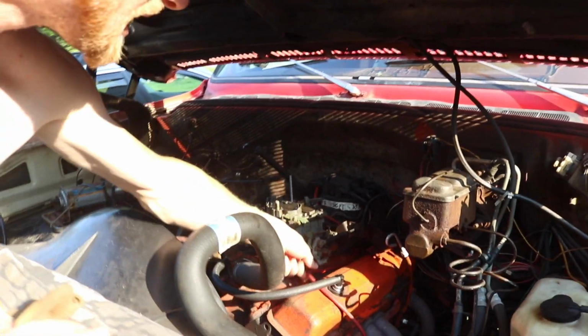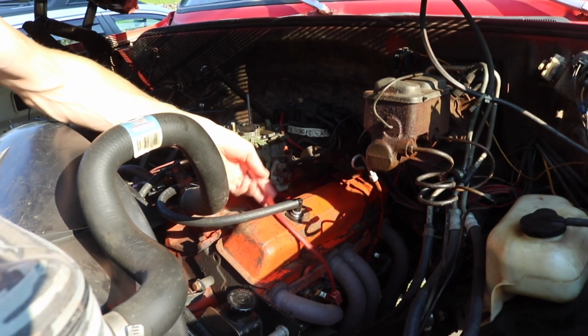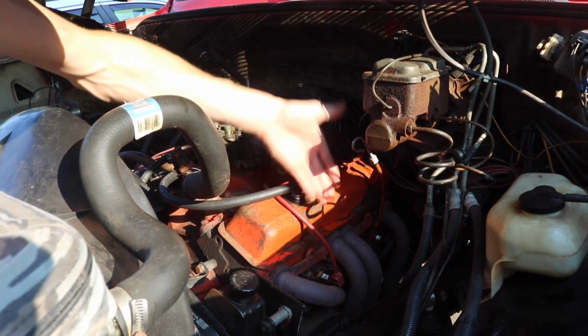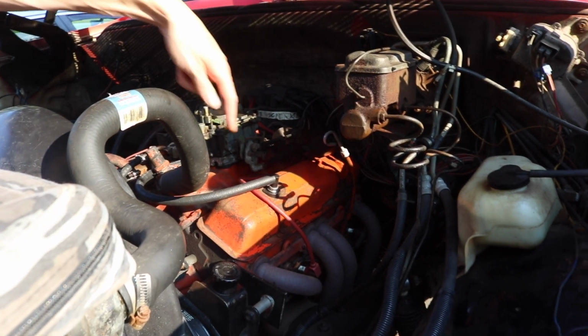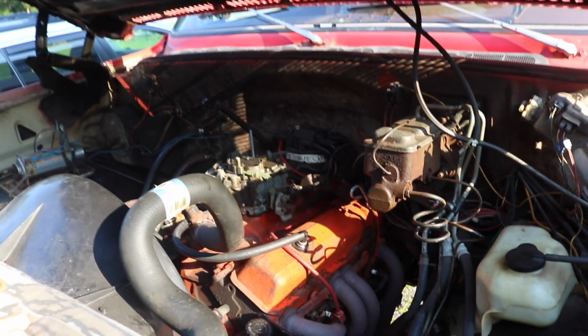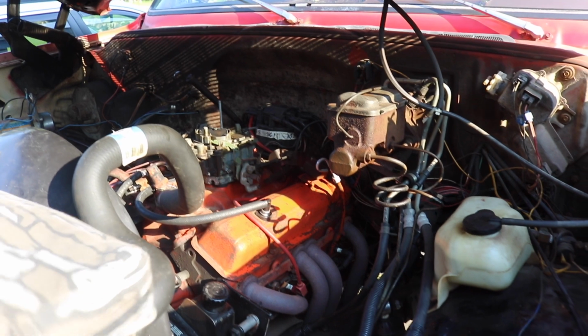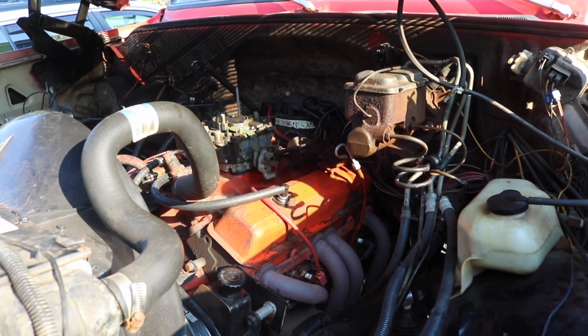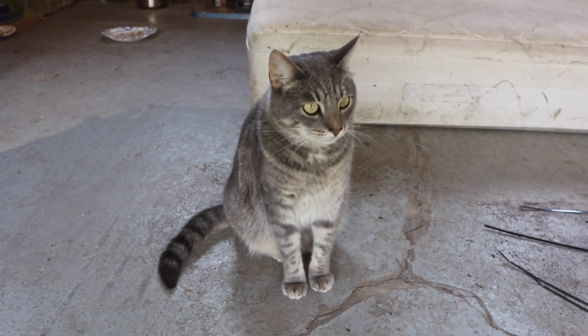So I just changed out this one spark plug wire, and I routed it the way it used to be over everything because that's the way it fits. So I had to go through and re-zip tie all the zip ties so that stuff doesn't burn against the header like I had it before. So just got that done. Takes a little time. Now I'm going to put the air cleaner on it and go for a test drive and see if it fixes it.